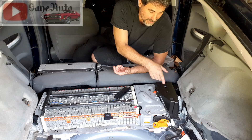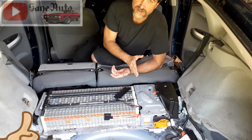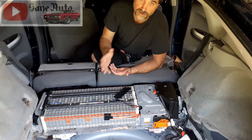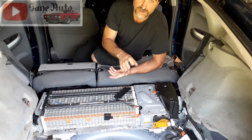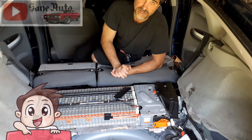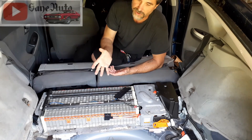The most common cooling problem is a dirty fan. First, second, and early third-generation Priuses had no filter screen, so the fan gets really nasty — check out my video on cleaning the high-voltage cooling fan to see how bad it can get. Later third-generation, fourth-generation, and newer models have a filter, and those filters can get clogged. If you have an earlier generation without a filter, I have a link in the description to a screen and filter material you can use to make one. The fan can also go bad and need replacing.